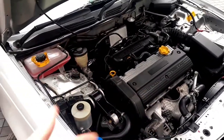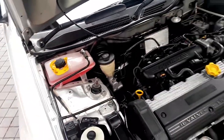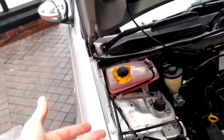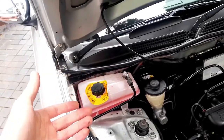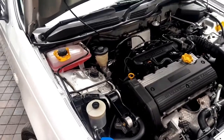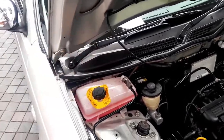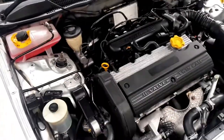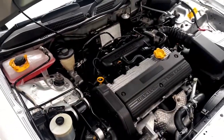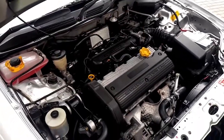That is basically how to install new coolant into a K-Series and do it properly. Again, I say again, the technique of holding the tank up while you're filling is a good thing to do if you're concerned about air bubbles. And as proven by me today with my gargling OAT coolant technique for filling, it can get a bit funny sometimes. But anyway, I'm going to leave this here. The ECU has just stopped making a buzzing sound. I will see you very, very soon.